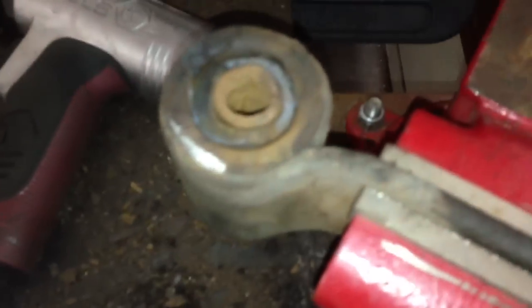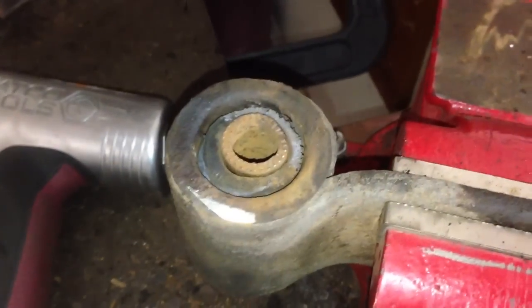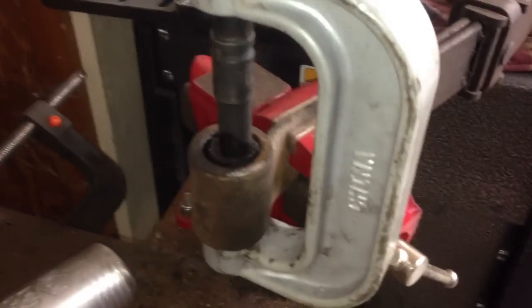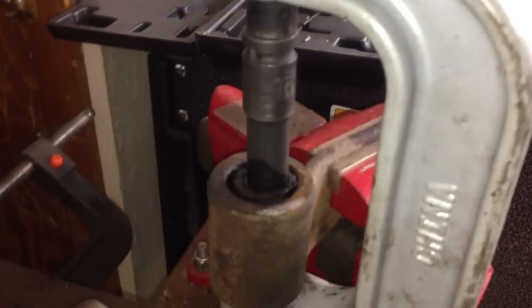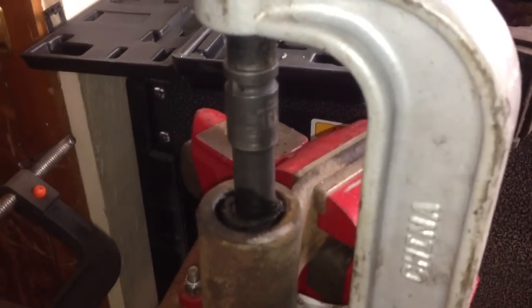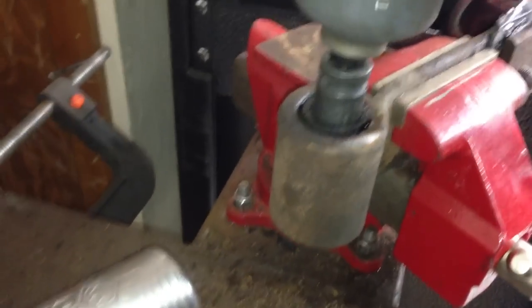I went ahead and clamped it in the vise. As you can tell this bushing is pretty much shot — not a whole lot left on it, pretty caged in. First thing I'm going to do is press out the inner sleeve. I have this cheap Harbor Freight ball joint press. It's Harbor Freight, but if you take care of it and grease the threads up, it lasts a long time — I've done at least a dozen u-joints and upper control arm bushings with it. Paid for itself for 70 bucks.